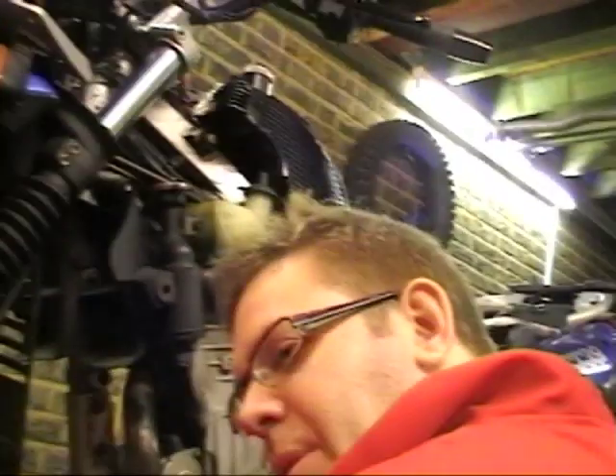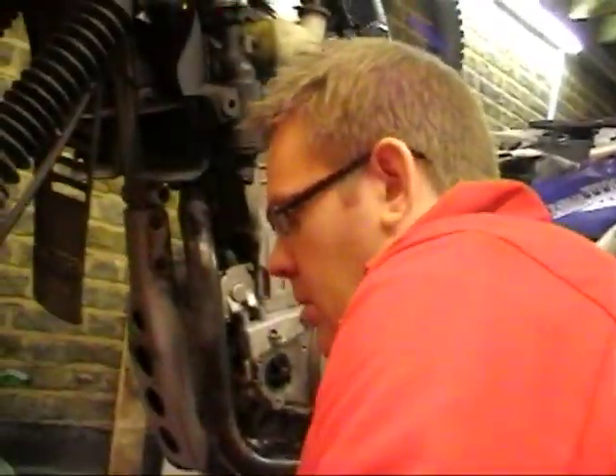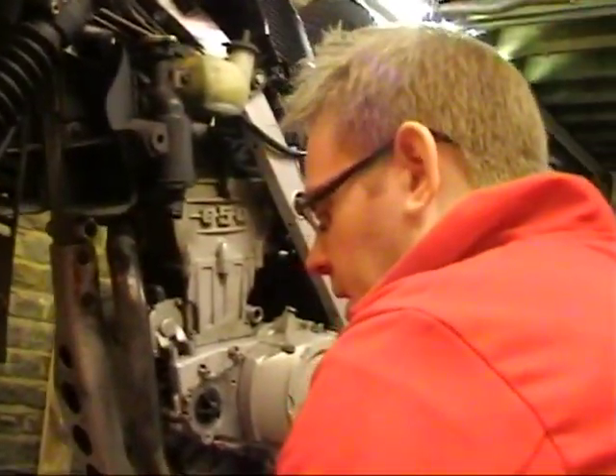I've done a couple of fingerfuls now. We'll stick another one in and you'll probably find this one here won't go in very much. By the time I take my finger out you'll see there's still quite a lot that comes out with my finger. The bearings can come up in your hands and sort of pop out sometimes. These are caged ones — the little individual needles don't come out. Yeah, if the cage is intact. These are actually quite big, sturdy bearings — quite tough and strong. Obviously it's quite a big bike so they need to be quite strong. It should be easy to slide it back in.